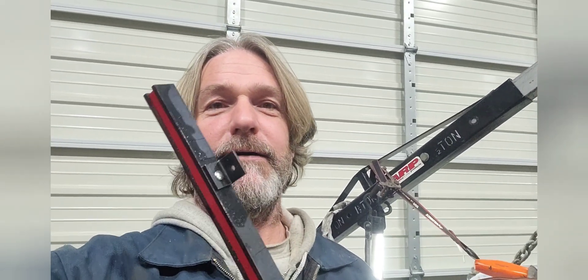As you can see the engine behind me, the magnetic strip — this thing right here — it's pretty handy for that. I was struggling; I ain't got that many clamps to hold it up. If you've got one laying around the shop or want to go purchase one — I've even got the wood dowels they tell you to drive down in the lifters and pull them up, but even that was a pain. This method works with the tappet cover off. If you're not going to pull that cover off, then you've got to put the dowels in and pull it up that way. But this method I thought was a lot better. Until the next time.